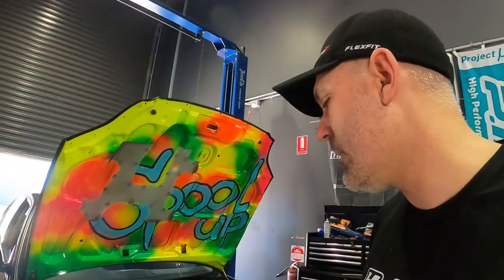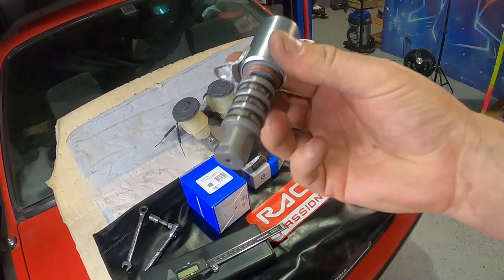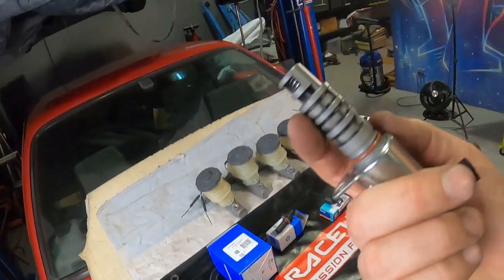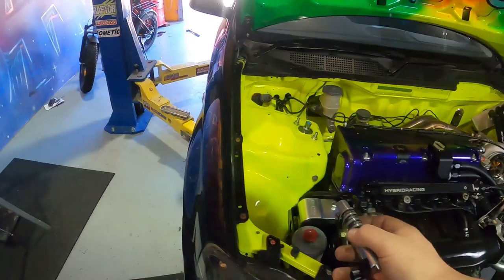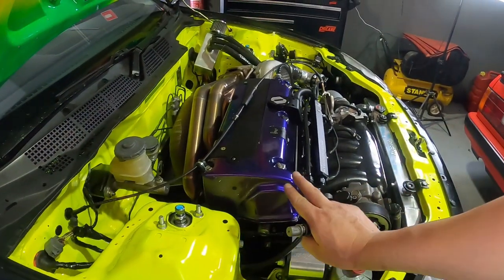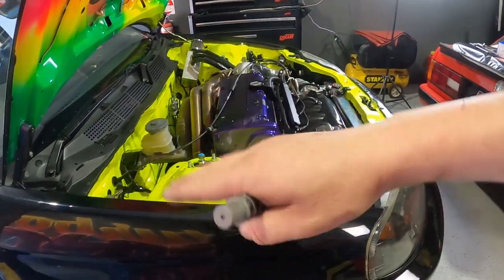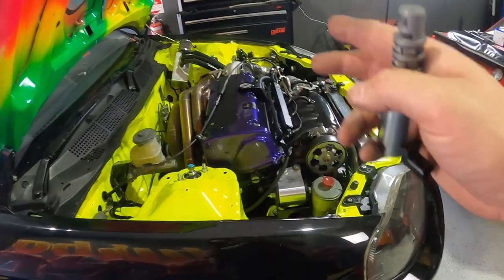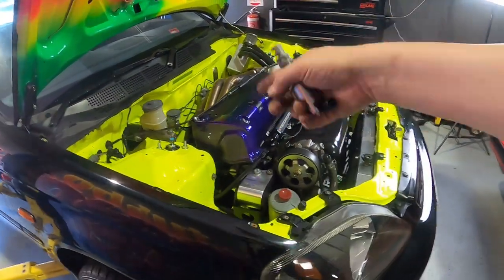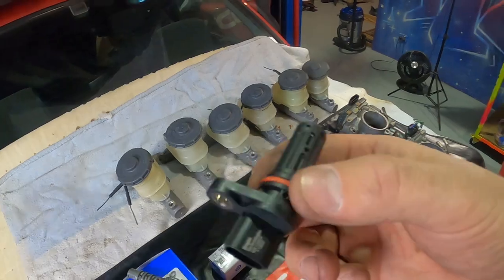It would flick on and off — you'd have to turn the car on and off, wait a minute, kick it back on, clear that code off the Haltech, and off you go. It doesn't always happen; for the most part it's pretty good, but it's just one of those things I don't want to deal with. So I'm going to replace all the sensors. The very first one is the variable camshaft actuator — this is what it looks like. It pushes oil pressure into the variable cam actuator and helps adjust the VTC gear, in my case up to 50 degrees — 25 advanced, 25 retard.